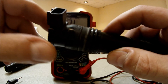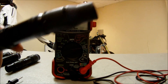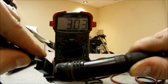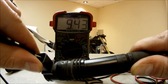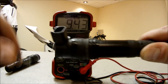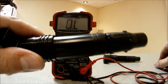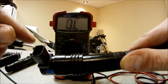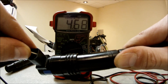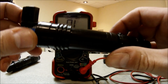So next I'm going to measure secondary resistance. I'm going to measure resistance between one of the pins and the spark plug end. So let's go ahead and test the stock ignition coil. All right, so we're looking at 9.43 kilo ohm. Now let's take the Dynatek ignition coil and do the same thing. We're looking at 4.68 kilo ohm, so the resistance on the secondary circuit is lower.